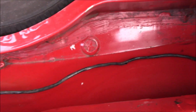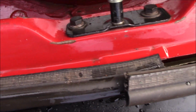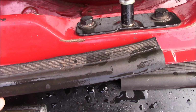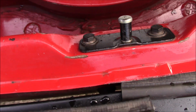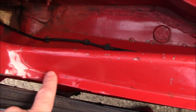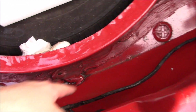Leak inspection time again. Water has been getting in, that's the inside of the rear glass. But it's not getting in where it was before. I noticed this time it's getting past this seal, which is the tailgate seal. And you can see there where it's wet, just these darker patches. It's overflowing the seal and collecting on this lip, and then overflowing there and collecting down here.